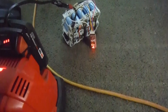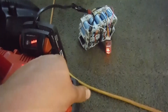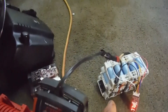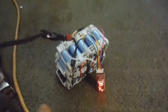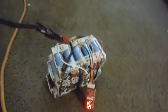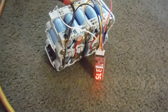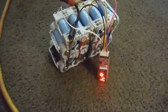Hello YouTube. Some of you may remember my 1.5 amp Milwaukee battery with this little lead on it — we made a 15.6 amp Milwaukee battery. Since then, we've been using this little 6 amp 18 volt piggyback to jumpstart cars. Basically, I connect the 18 volts to a car and leave it sit there on the car battery for two or three minutes while I'm watching the little cell monitor. And once it puts a bit into the battery, give it a quick hit with the key and away it'll go, even with tiny jumper leads.